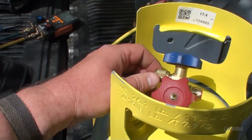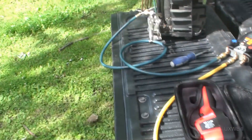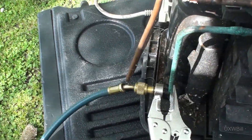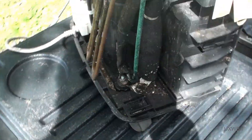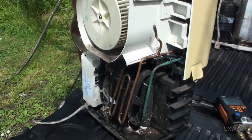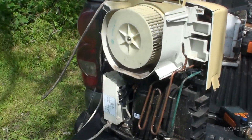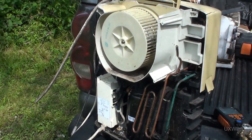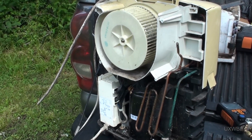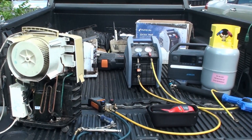And here again — much the same kind of thing. We should only get the tiniest little spit of refrigerant gas out of there after I've gone ahead and purged the machine, and the same thing will be true down here. Just the tiniest little spit. There's the puncture, and that's all there is to it — it's over. Now these can go off to be scrapped or recycled or whatever they need to be from here. So now the video does truly conclude. As always, thank you for watching, and certainly feel free to leave a constructive comment if you happen to have one.